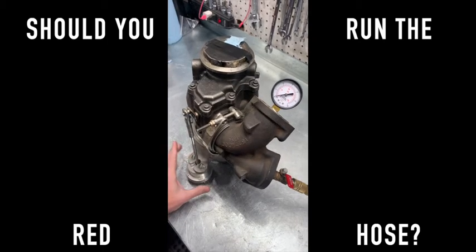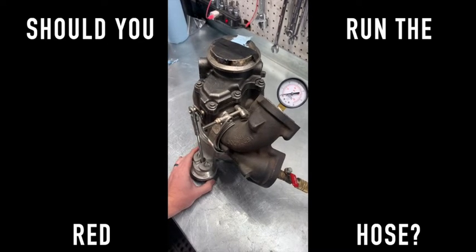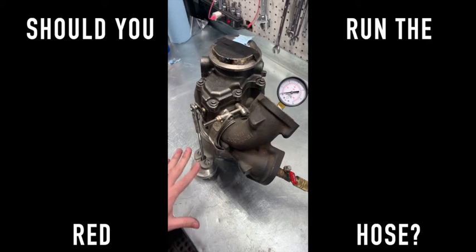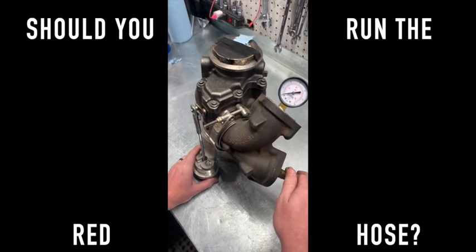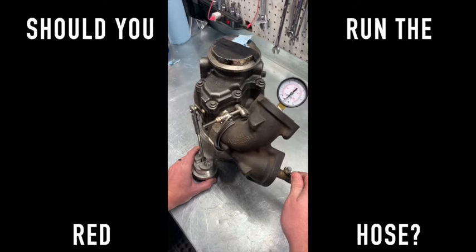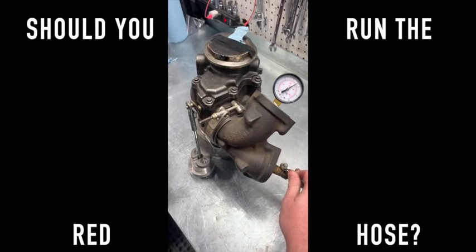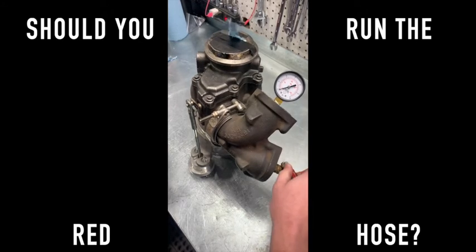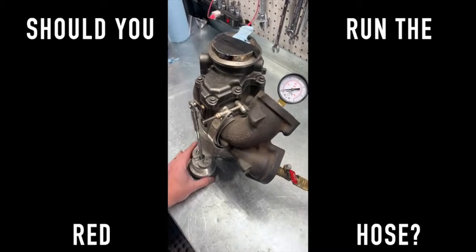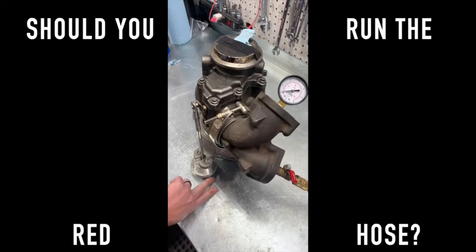Something else we've heard is: what happens if you vapor lock this? Don't cap it - or do cap it - it really doesn't matter. It's just a spring in here, that's all it is. That little tiny bit of pressure from that being on there will have zero effect on the gate. It's just a giant spring in there. In fact, some people sell this unit without the nipple on it - it's literally just the spring on it. But just for fun, I'm going to put my finger on it and open it up. It makes absolutely no difference whether this has got a cap on it or whether it doesn't. You can break the nipple off, any of that. This is used for setting the pressure of the turbos and testing it. If you don't hook the red hose up, it doesn't matter whether this is plugged in or not.